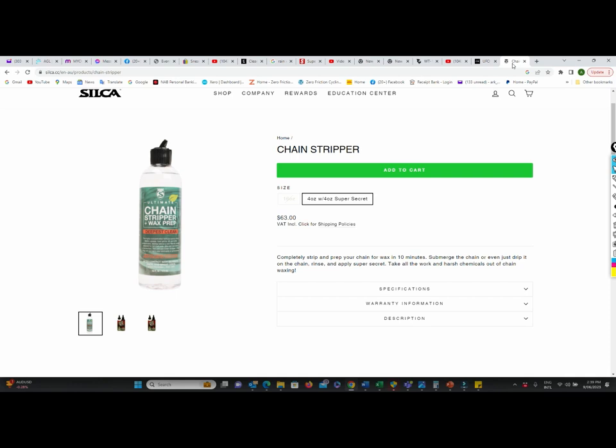On one side, these products make the job easy because they're super concentrated — they make cleaning or stripping the chain of factory grease quite easy. The other thing is that for an on-bike clean, degreaser or mineral turpentine does okay, but it's really difficult to get a perfect clean of factory grease because factory grease is pretty stubborn, especially right deep inside the chain.